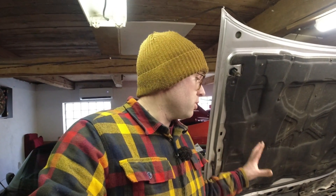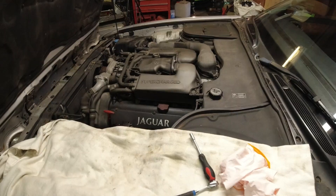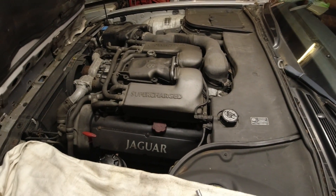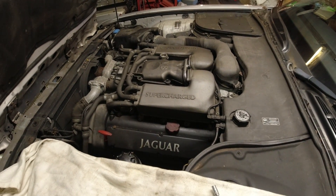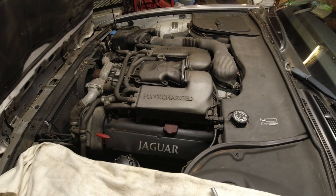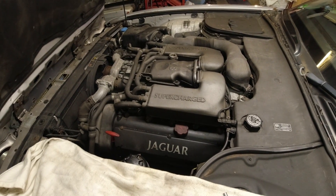I'm going to show you how to have a look at it — it's pretty easy. Unfortunately you can't just look into the engine; you need to actually take apart the valve covers. We're going to do that and get in there. It's pretty straightforward even on an engine like this with the supercharger. I'm initially just going to tear down one side — we'll take this side because the intake is on the other. It also has a couple of codes; it's not running on every cylinder, with a misfire in cylinder one and cylinder two, which are the two front cylinders. We'll probably look at that in a separate video.